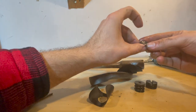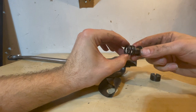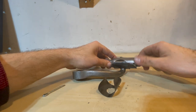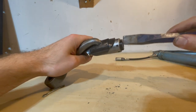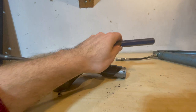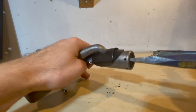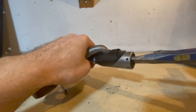Put the other spacer in so the indent is facing towards the ball joint, then with the spring pushing against the spacer, insert the spring and spring holder, and then put the nut on. Using a chisel here to tighten this large nut works very well. Use a pair of vice grips to hold the chisel and tighten the nut all the way down until it's secure. Then back it off half a turn as per the manual so it's in the right setting with the spring.